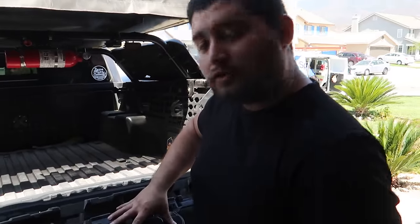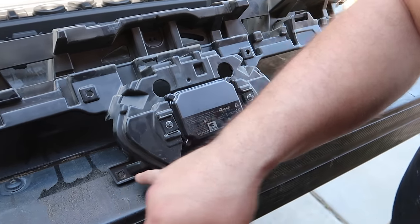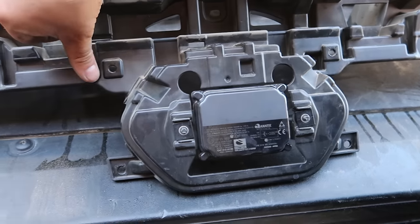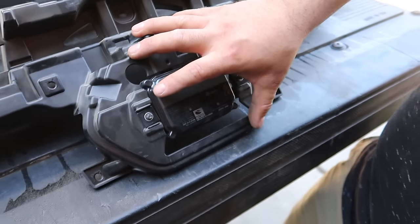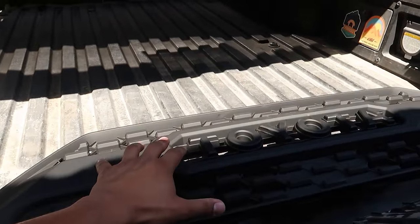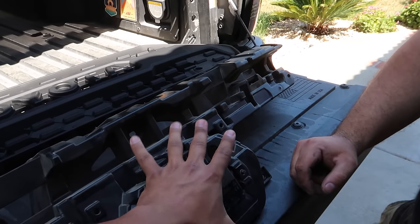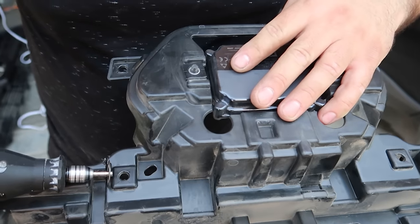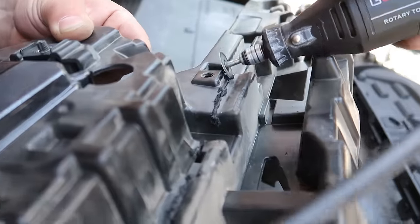At the point of the install where we have to retrofit our radar sensor onto the new grille, we need four holes from the old mounting bracket — this one and this one, the two bottom ones. We're going to cut right here along the edge, straight across, and then back down until we get just the center section out with the radar sensor. We're doing that because we're going to mount that section on the new TRD Pro grille. The top section we're not going to need anymore. For this, get yourself a Dremel — Harbor Freight has them for super cheap.